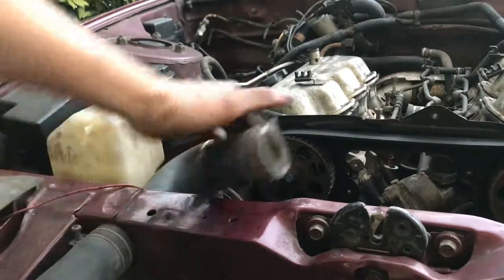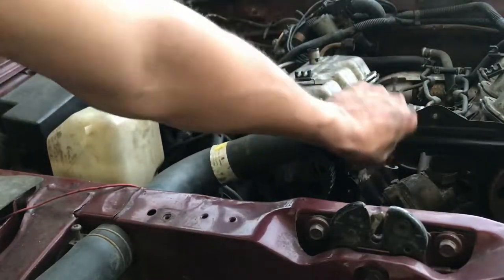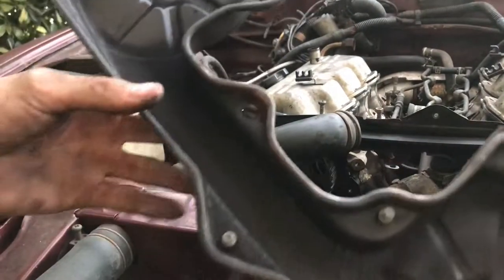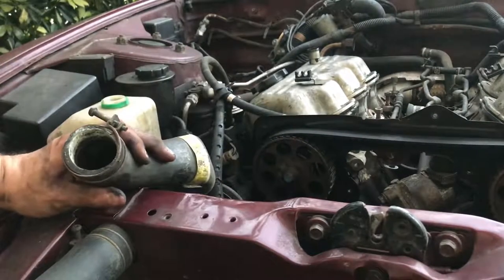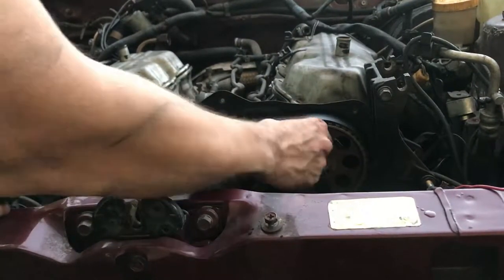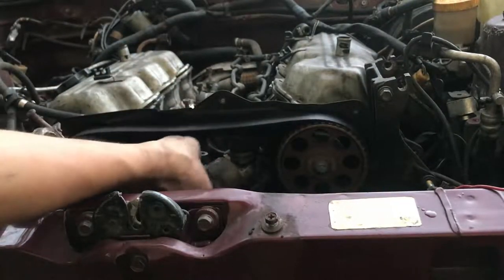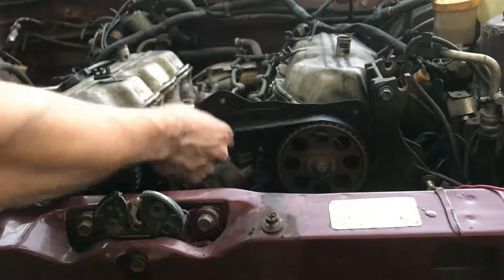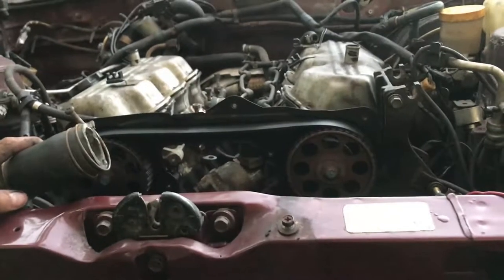It looks pretty good. The tension, unfortunately, is not that great — I feel the tensioner has most likely gone bad. Add that to the list of parts I need to buy for the Z. Fortunately, the gaskets seem to be in rather good condition — I'll be replacing them anyway, but at least they kept moisture from getting into the cams. This cam gear concerns me — it's kind of rusty, but still looks quite strong. My main concern is the amount of deflection in this belt at idle. It seems the tensioner has completely failed, or the timing has jumped or stretched, which is why this car doesn't really like the hot start.